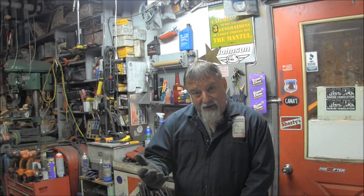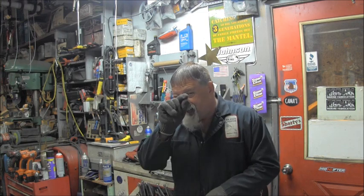I knew. And the severity of these things getting oil all up in the cylinders and hydrolocked like that, I think, depends largely on whether they were just kind of laid on their side, tilted maybe a little too far, or completely maybe even inverted upside down. I have seen that before. I don't know if you saw the video, but I had a Jet 30 Mercury. This thing had been stood on its head full of oil, and it was brutal to finally get to pop.